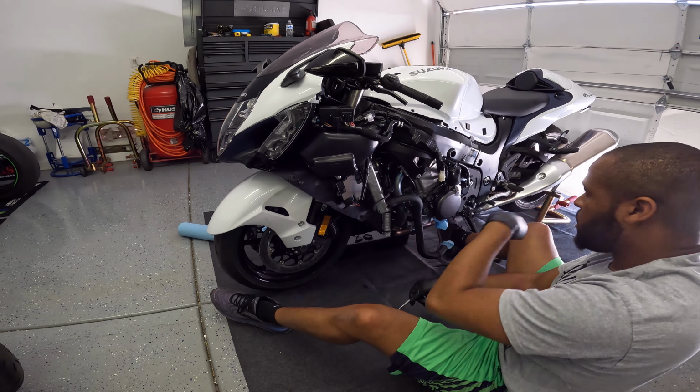So the exhaust is off. Now, on the oil cooler, I kind of scraped the back side of it a little bit, so I'm gonna try to straighten out some of the fins on there. But as far as the removal goes, that's pretty much it. I'm inspecting here, making sure nothing's cracked from those bolts being bent. Fix those fins, and yeah, I'll get back with y'all when I start winning.